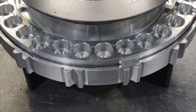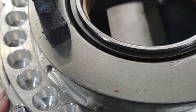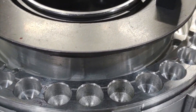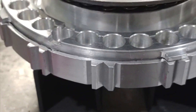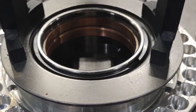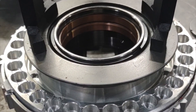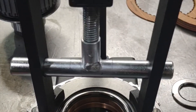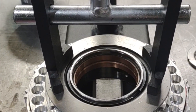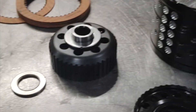The direct clutch housing springs — there are quite a few of them. They don't look that beefy but they really are. Again, you've got to make sure that your ears on your piston are lined up with your housing. You've got to get the piston spring retainer down quite a bit to get that snap ring in. As you can see I'm using a Turbo 400 style intermediate sprag spring plate as a brace so that I don't deform the spring retainer — that's how heavy the springs are. It's a job to get that down far enough. I got my traveling spring compressor out so I could do it on video instead of my foot press. Snap ring's in there and I'm ready to let that loose.